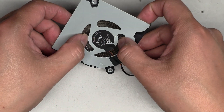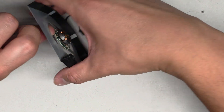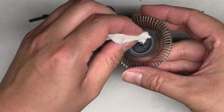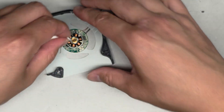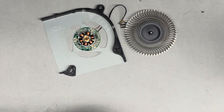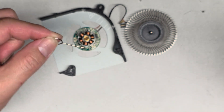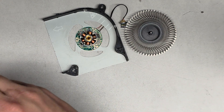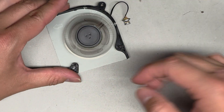So we're going to pop it out again and wipe it again to see what color it is. If it's just the yellow of the oil, we're okay — and you can see it's pretty much just the yellow of the oil. Usually what happens is dust, dander, smoke, and humidity when the fan spins over time gets into there, and the grease that's there no longer lubricates well. Some people tell me there's no grease and it just floats, but every time I add grease to these it fixes the problem. So we put another drop of oil in there and go ahead and put this back on — you can see how nicely it spins.